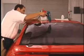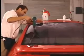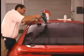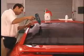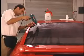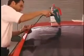Using a circular motion with your heat gun, work the window in quarters, from the center out and pulling the film towards the factory edge. Allow the shrinkage to occur throughout the entire area instead of just in tiny bands as you would in the wet shrink method. This also eliminates or helps to reduce iridescence or ghosting with all metal films and allows you to shrink a harder curve more easily.